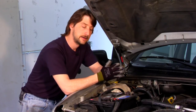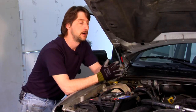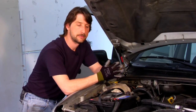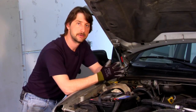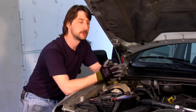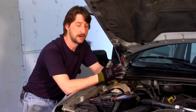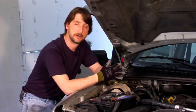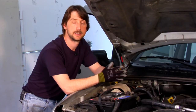There's one thing you want to keep in mind when talking about cold cranking amps. When you look it up in your owner's manual or at your auto parts store, keep in mind that for every three years of age your vehicle is, you want to add 10% on the cold cranking amps. As your vehicle gets older, it's going to take more power to turn it over. So if your car calls for around 800 cold cranking amps, you want to get something closer to 900 the next time you get a battery.